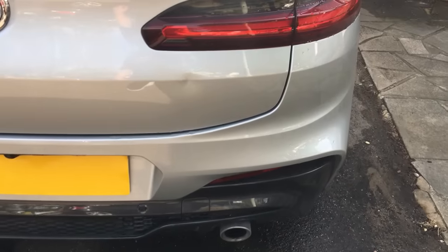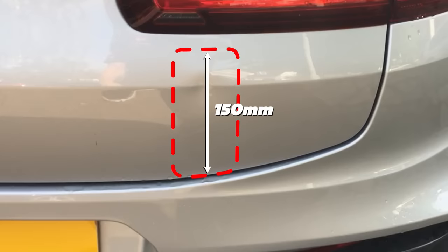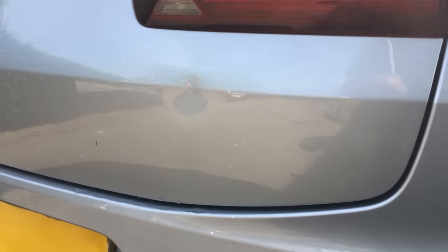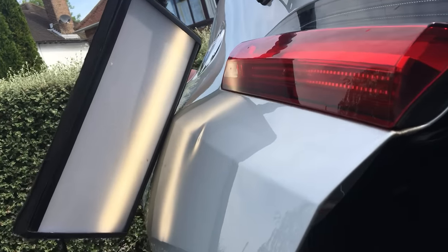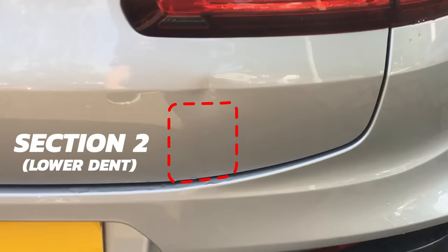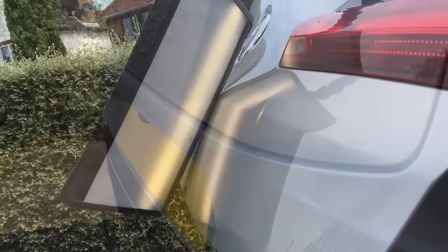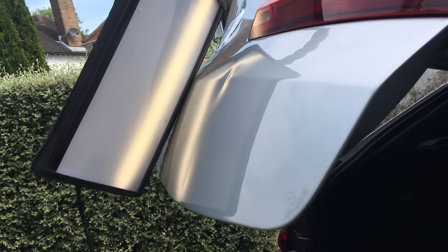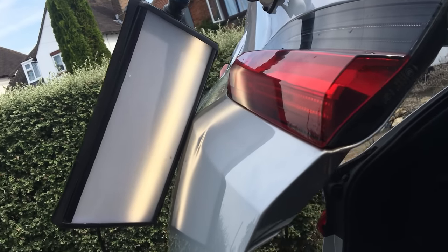Looking at the panel head-on, the total damage covers an area of approximately 80 millimeters by 150 millimeters, because there are two sections to this damage. Section one is the main dent right on the body line, which has taken in an area above and below the line and created crowns around the perimeter. Section two wasn't very obvious from the start — this is additional damage going down to the bottom of the panel, which may be difficult to access from inside, especially as it gets closer to the lower edge. This is why it's always important to check around the main damage for any additional damage.